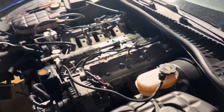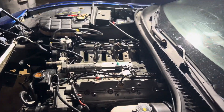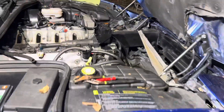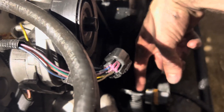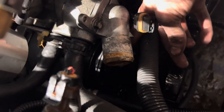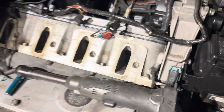Here's an update — got the radiator out, that was a pain. Definitely did not think it was going to be that involved, but there's a look at the radiator. It's a good thing I wanted to do this and get it all cleaned out — now a lot better cooling. So now I'm going to go ahead and pull the water pump off, and then the power steering pump and alternator bracket, and I'm probably going to try to get underneath it and drop the AC compressor bracket off of the engine.